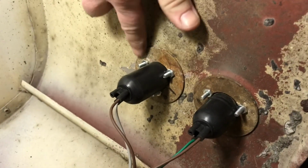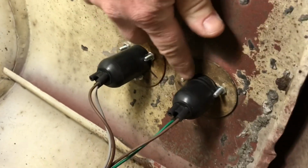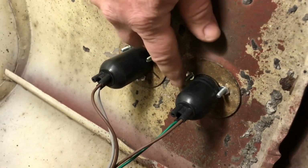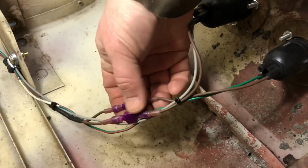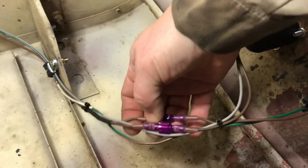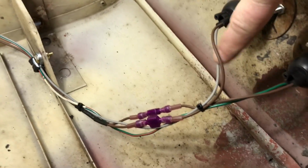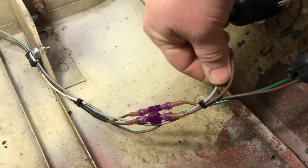And here's the retainer plate that goes behind it. And then here are the number 10 bolts that I have going through there. I think they're about 3/4 inch, or maybe an inch long or whatever. So they go into here and come together. And I made a pigtail, single wire for the ground, so it can come over. I got a double pigtail here. It goes into the ground, so the brown can be put together. And then I got the turn signal and then the marker light.